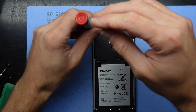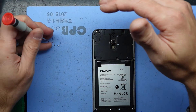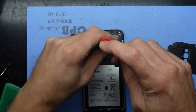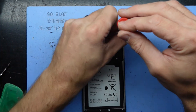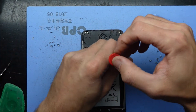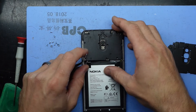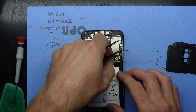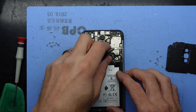This is mostly also useful for data recovery of older phones where parts aren't available and people require information or data off them. What I would recommend is just purchasing a whole other phone and transplanting the body, as is happening in this video. This one has an overall simplistic design, as opposed to some other models — similar to what I'd see in an Oppo or Xiaomi. Samsung's are usually a bit more complicated with more screws, whereas on this particular one there are no hidden screws; it's all held down by that plastic shield, which makes the job quicker and more straightforward.